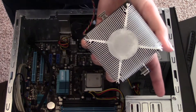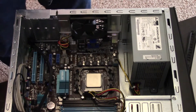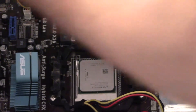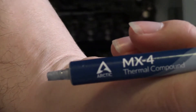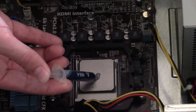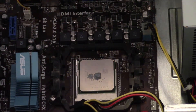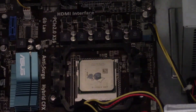It looks about as clean as we're going to get that heat sink. Let's reapply some thermal paste and we'll be good to go. Just got some Arctic MX4 compound. Let's put some on here — should be a good amount, it's a little larger than a pea size but should be fine. It's an AMD CPU from an earlier generation after all, so it's going to run hot.